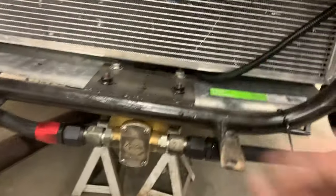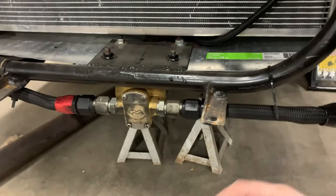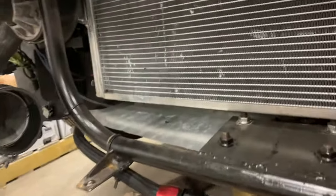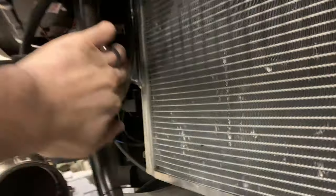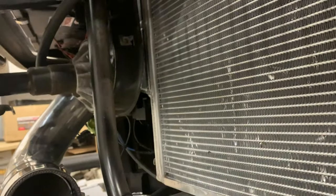I'm going to tilt the radiator up a little bit — if I can move the bottom of the radiator forward, that'll give me more room behind it and allow me to fit a larger fan. To do that, this part of the radiator support shroud has to come off. I might just cut that a little bit and I think I can squeeze the radiator up just a hair — let's see how we do.